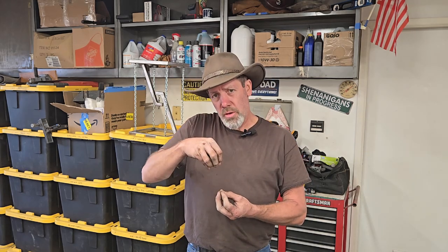You torque them and they'll stretch a certain distance, and then you put them back in. They might stretch and back off on you later on. Also, I'll have new valve seals. I'm going to hand lap those valves, clean everything up, and in the next video, we'll put that back together and I'll show you how to hand lap the valves. Hopefully, we'll have some great seat activity, and we'll have us a Renix head ready for Moab this spring.